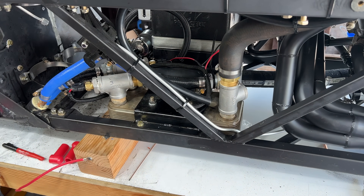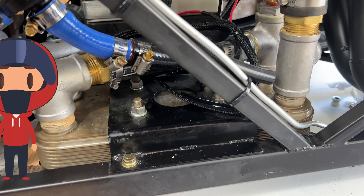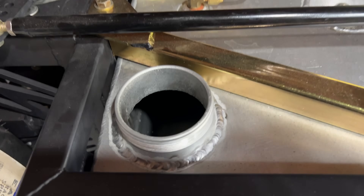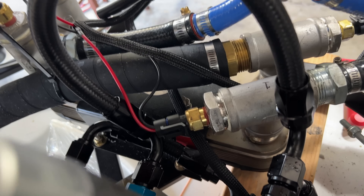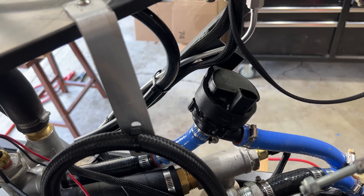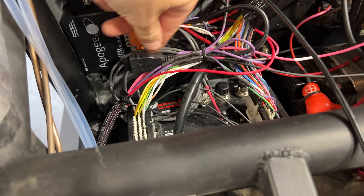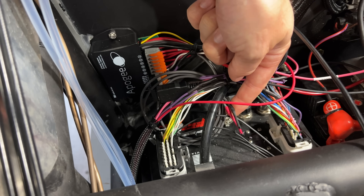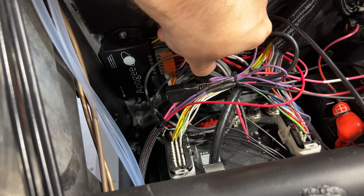Later on, we had it started and running well, but the engine was starting to overheat. I mentioned this in my last video, but I didn't actually size this heat exchanger — this was just a guess-and-test engineering decision. The engine was overheating, but the water in the tank at the front was barely warm. I could buy a larger heat exchanger, but it seemed like this one wasn't rejecting hardly any heat at all. Something didn't seem right — this thing shouldn't be that bad. Wait, did we forget to plug in the water pump? Oh, we did. The cool thing about this power distribution module is it comes with temperature probes. You can set up any of the outputs to PWM based on temperature, so the pump doesn't come on until a certain engine temperature and then slowly ramps up its speed as the engine gets hotter. I just have it on all the time right now, but this is a possible future addition.